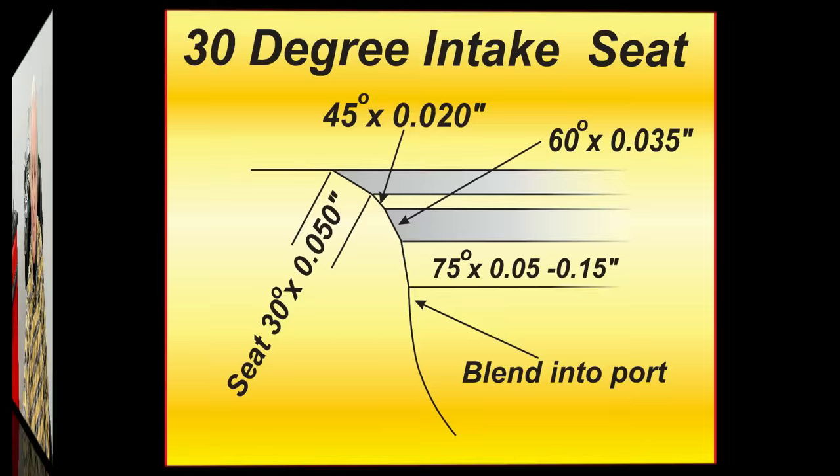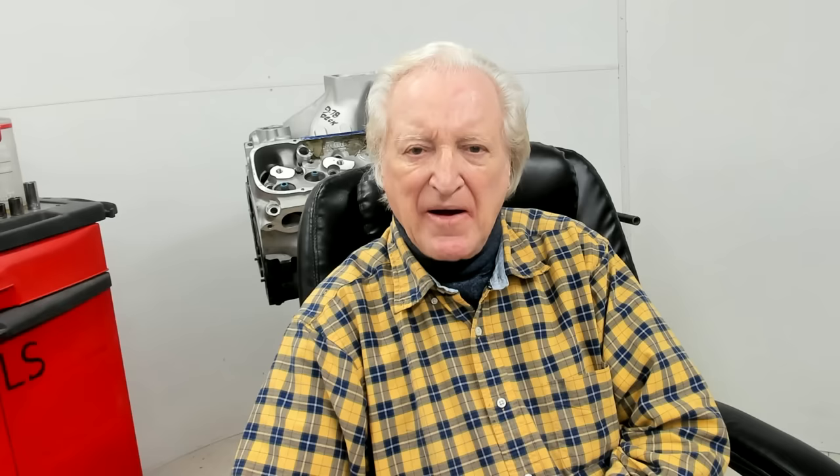The 30 degree seat has its own set of drawbacks. These drawbacks relevant to valve seat angles all cropped up while I was doing research for anti-reversion valves for my A-Series Mini engine — that's the original Mini Cooper. I was racing one at the time and certainly couldn't afford any of these fancy Cosworth engines, which were costing more than my house. That meant I had to research the iron-based race engine using the original type head, modified extensively.